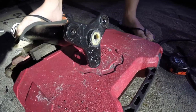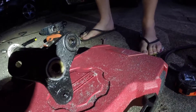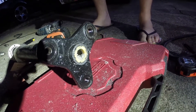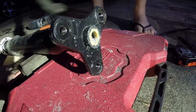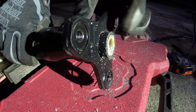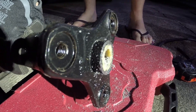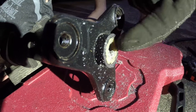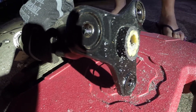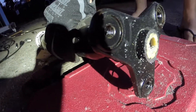The reason I did that is because I couldn't find any six-inch jigsaw blades for cutting metal — I guess they don't make them. So I'm using a four-inch jigsaw blade, and I had to cut this off so the four inches would grab the entire length of the bushing. What I'm going to do is basically pie cut it on all edges as many times as I feel comfortable, and then simply pop it out with a hammer.